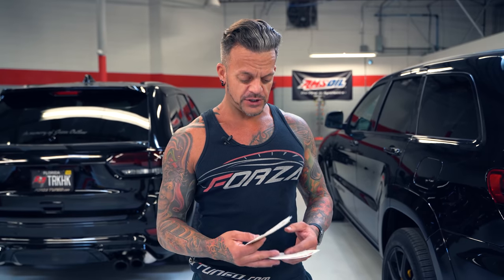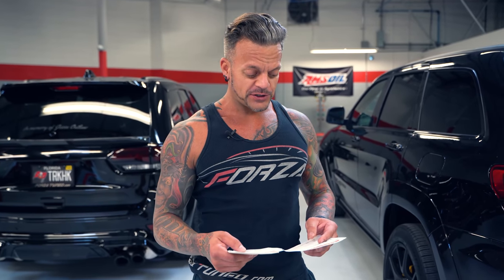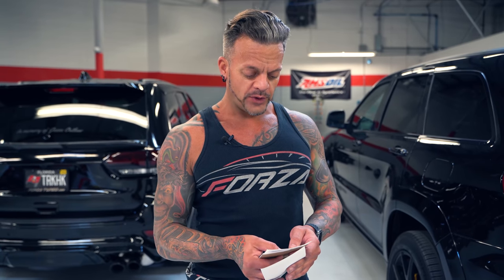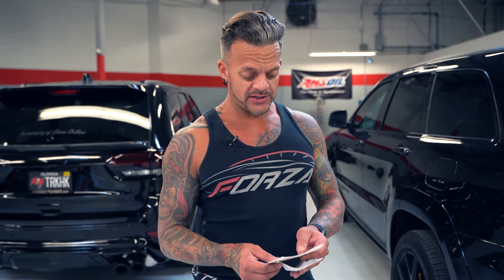The Demon Hawk gets incredibly hot. Run 1 started at 126°F — lower due to the duty cycle on the coolant pump in the tuning — and hit 171°F at 87 mph, adding 45 degrees versus only 11 on the stock unit. Run 2 went from 133°F to 177°F. Run 3 went from 136°F to 179°F — consistently adding about 45 degrees while also starting hotter each run.